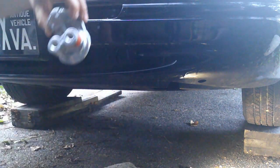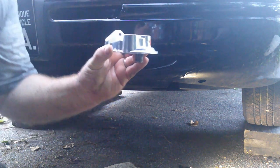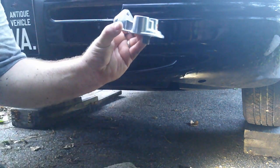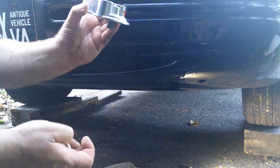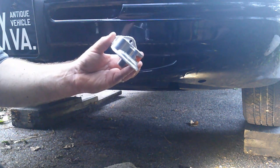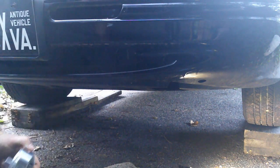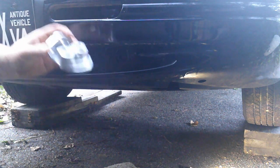another thing I want to mention is the reason I really want to put it up under the battery is I'd like to be able to mount it like this where my filter comes up under it, because GM does things that way, and the real advantage of that is you can fill your oil filter when you put it on, and it doesn't take as long to build oil pressure. It cuts down that dry time the engine's running. I just think that's a much better design than Ford that puts them in sideways, or like my Dodge truck, that Mopar, where you put it in right side up, so there's no way to put any oil in it. But nonetheless, if I can get it to where I can do it GM style and really take care of my engine, that's my preference.